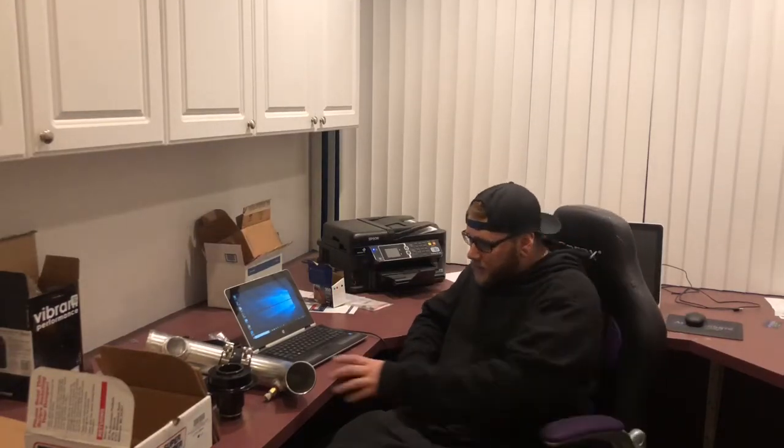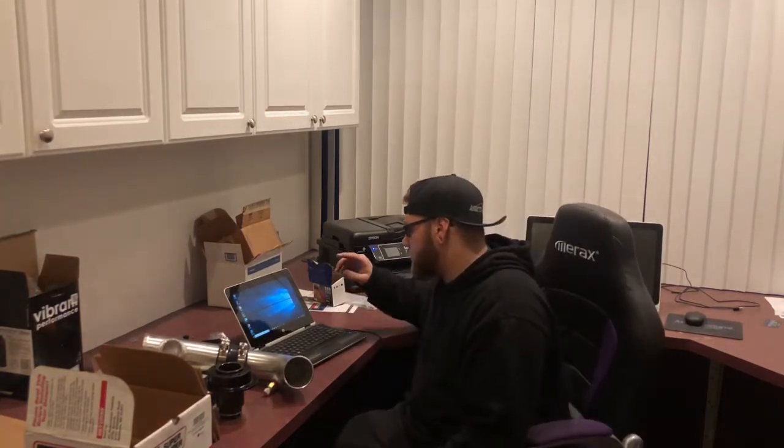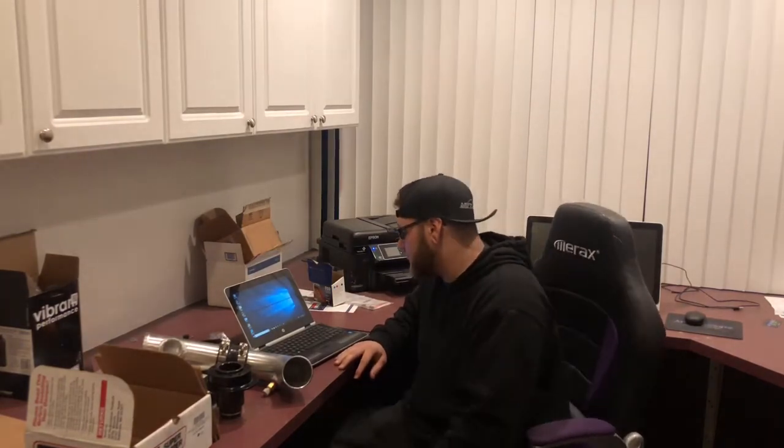I was just coming by to drop some stuff off because I'm headed out of town for the weekend pretty soon. But I figured I'm here. I have everything for the car to theoretically run. So I'm going to put the map on it, get this intercooler piping back together, and then fire it up and just basically make sure all the engine stuff sounds good, see how it sounds with the new exhaust and the motor work, and just leave the belt off the supercharger because it's still waiting on the new brackets to relocate it a little bit.